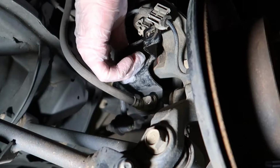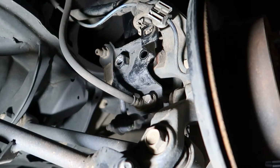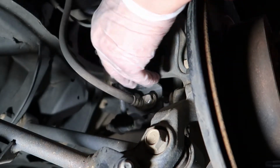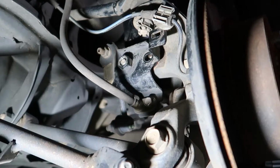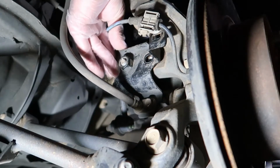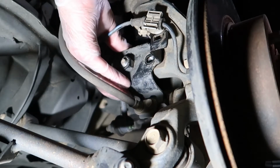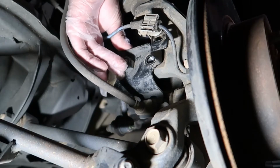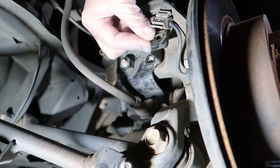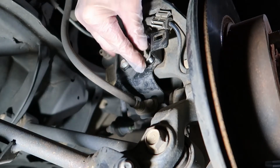So this may take a minute. Take your time. You definitely don't want to misalign it or strip it. So be very careful here, and you'll be able to tell once it actually catches. So you can see at this point, I've actually got the bolt to pass through the fixed nut and it's starting to clamp down. But you don't want to go too far with this bolt. You want to stop right around here once you get that much thread coming through so we can line up the other bolt here.